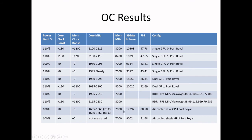One of the most important benchmarks was comparing my air-cooled system. When I was air cooled, the core clocks were very unsteady and quite low. The big takeaway is it was worthwhile doing the water cooling: the core clocks became very, very steady. With air cooling, they were bouncing around all over the place with all sorts of thermal limits going on — as temperatures rose, it was driving down the core clock frequency to compensate. Big difference between the frequencies you get air cooled versus water cooled.